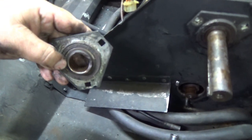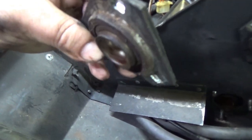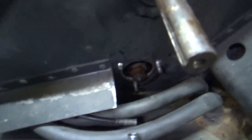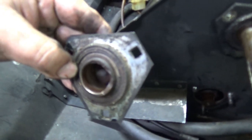The clutch side driveshaft bearing didn't fight me at all because it's broke. The set screw didn't do anything — the set screw is still down there on the shaft. Good thing we were planning on doing bearings anyway.